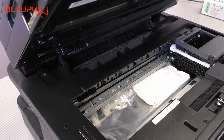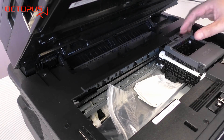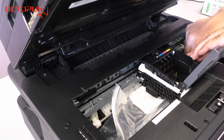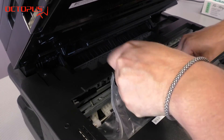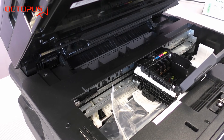The actual cleaning we perform in the middle of the area where the printhead compartment is usually working. The inks which are in the printhead shall be flushed out through the nozzles in the nozzle plate on the bottom side of the printhead compartment. To protect the printer and the working area we lay a sheet of plastic material and a sheet of kitchen towel into that area.